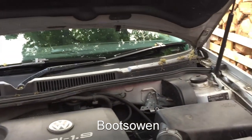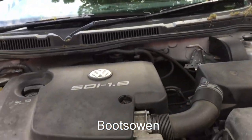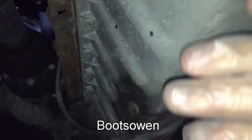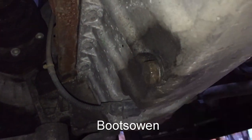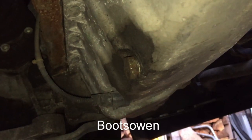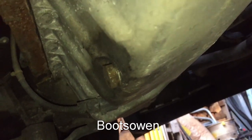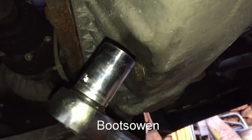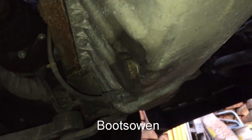This car has an automatic thing to keep it lifted up. So I'm in underneath the engine and this is the sump. It's quite hot and on the back of it, with this halo of oil around it, is a sump plug. It's a 19 mil, so I've got a 19 mil socket, but you could use a wrench or whatever.